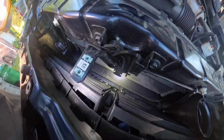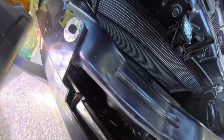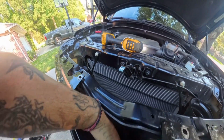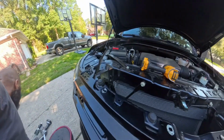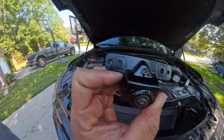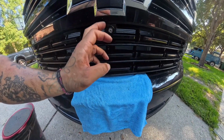See if I can get you a view. So earlier I said that hose at the bottom was the camera. That line, that's not the camera. The camera is on the inside, and it's hard to see. It's hard to get a good view. It's right, if you can see, there we go. You see where that light, that's where your camera is, where I'm shining that light at the bottom. That's where the camera is. So that's where we want to get. And as you can see, even with the little play, my hand barely fits in there. The camera sits like this. There are 2 T15 bolts, one right here, one on that side holding that camera in, that we need to take apart. It's on both sides right here.